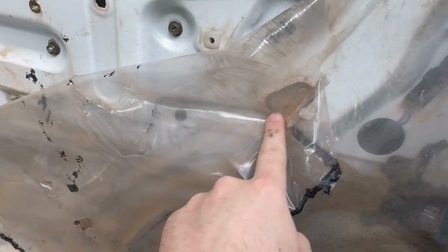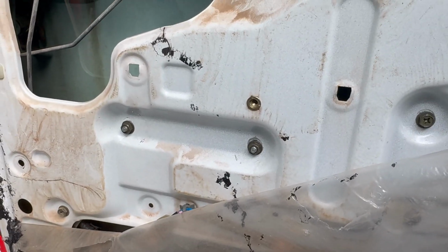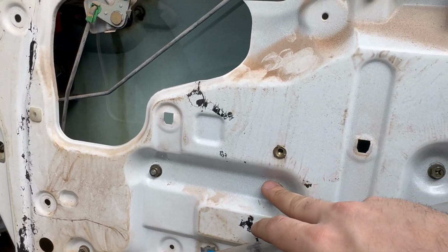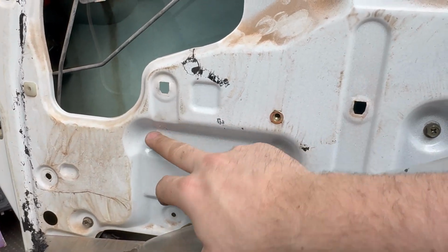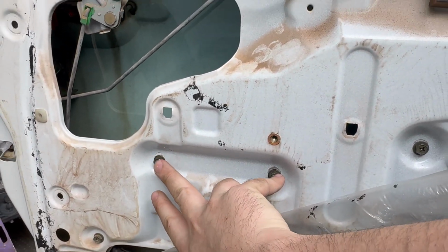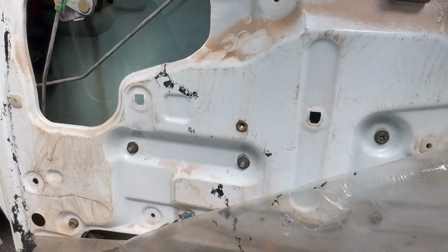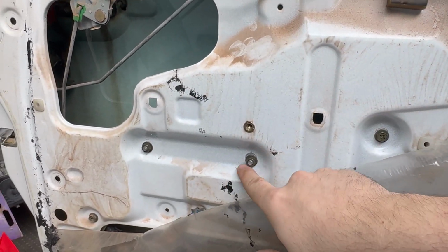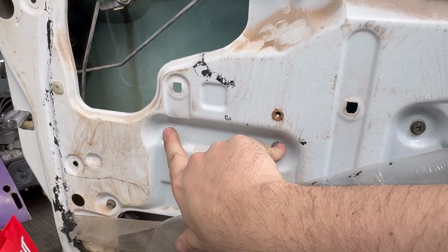So then yeah, just secure the 4 bolts, and then over here it's very important to note that when you install the electric windows, just set these 2 bolts at their lowest position, just for when you close the window, so it doesn't crack it if it puts too much upwards pressure on the window. So just put them at their lowest position and then tighten them up.